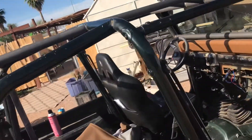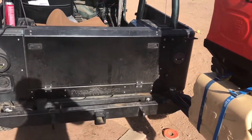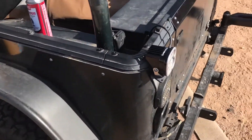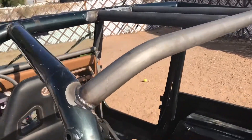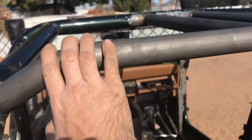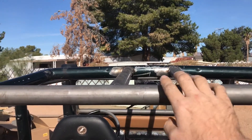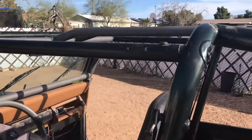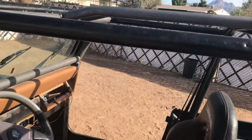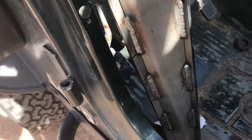I'll be taking those back. Here's an overview of the back — Poison Spider tailgate and trail corners. So the back one is actually pretty easy; it was probably the easiest part of the whole project. They set this one in as far back as it goes, then square these up with the front ones, tack them in, and then weld them — it really wasn't too bad. One thing I did notice: you lose use of your emergency brake. It's kind of a bummer.